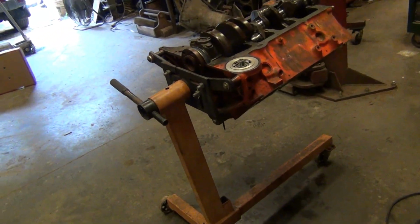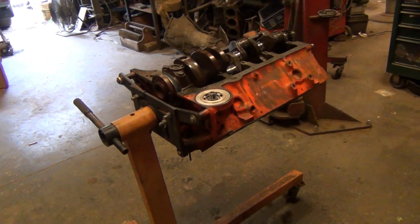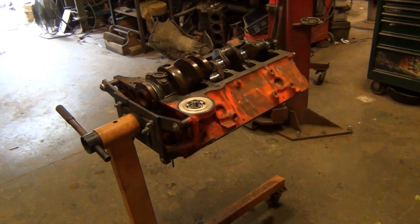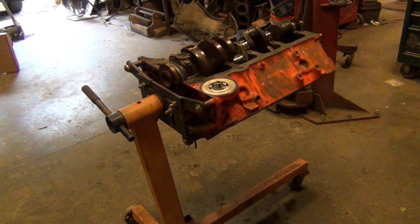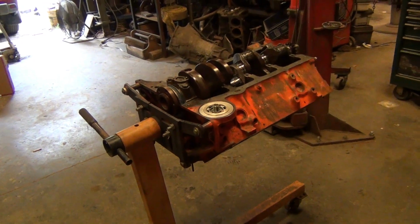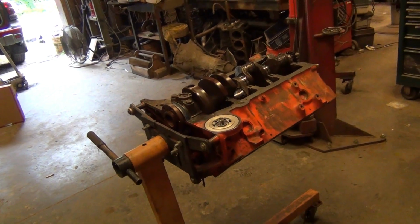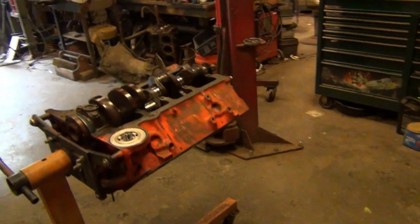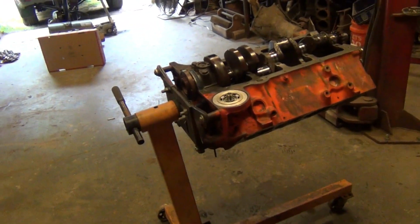They're good. But yeah, like I said, I was going to run an H-beam in this, but the weight was so, I mean, it was so heavy. Then it just upsets the whole balance of the crank, and then I have to go have everything rebalanced. It's just, keep it below 7,000, keep it at 7,000 RPM, and it'll live. I'm telling you, it'll do fantastic. It's 8,000, 8,500 is where things start to come apart. Just having a 3-inch stroke, I mean, you can get away. It's got a big bore and a short stroke, and that will make power. This ain't gonna be no power monster, but it'll make power. They just ain't got no torque. But that's why you got to turn them up like that.